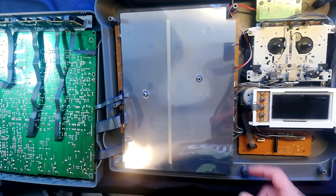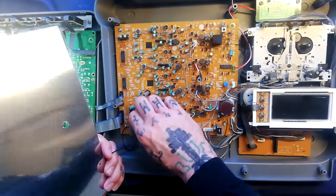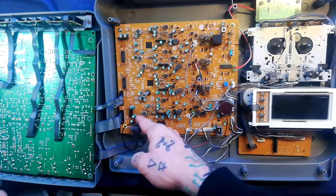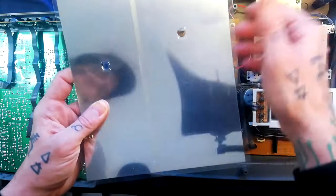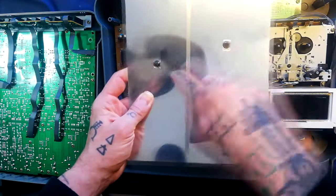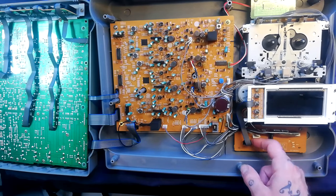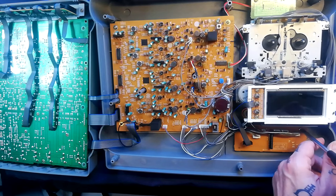I'm going to focus on getting the cassette player out first, so let's lift this shielding up. The way it connected is via a pin-and-slot connection from ground two, just in the bottom left of this board. You'll notice that the part with the plastic attached is on top — I suppose so the PCB doesn't short out against the shielding. To be able to get the cassette player out, change the belts and so on, it looks like I'm going to need to remove this display, which seems to be attached to this board via a ribbon cable. We'll get this board up first.